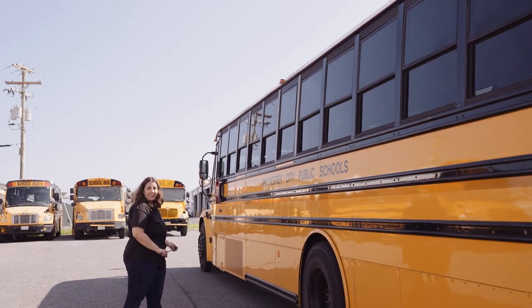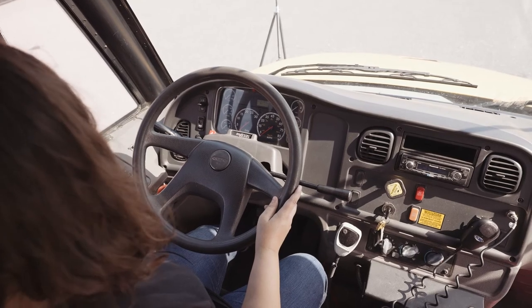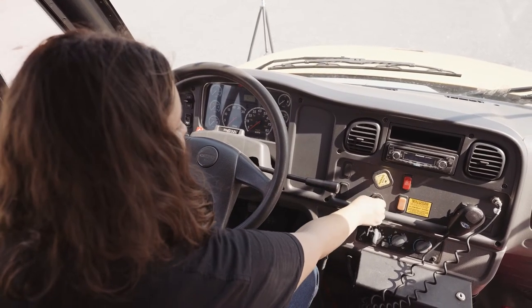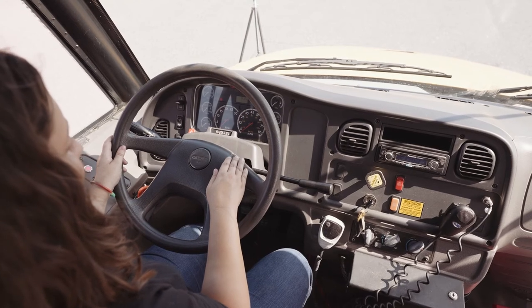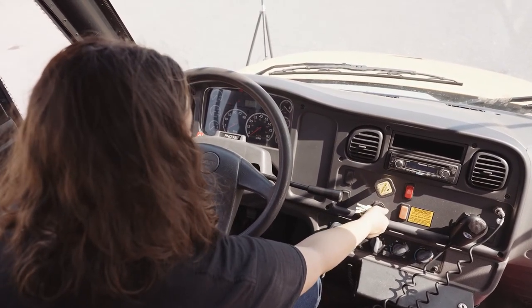And that concludes the lights check. I will now check that the light indicators were working. To do this, I'm going to start by closing my door. I'm going to set my bus into the run position for a safe start. That's for letting all the needles sweep. Now that it has, I'm going to start the bus.